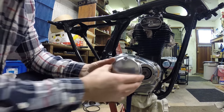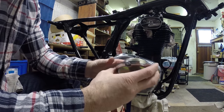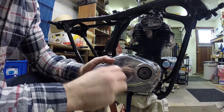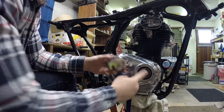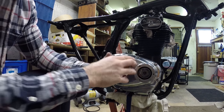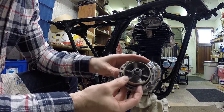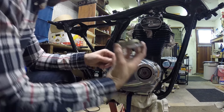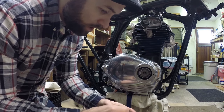The oil slinger cover has a little chip on it — that's a good reminder for me to just take it easy when working on this bike, learning how to be patient, because you can rush stuff and screw things up. There's no gasket here — just an O-ring rubber O-ring, which I already replaced. Slip this into place. There are two vital holes in the cover that line up with two holes here and here — make sure you look at it and put it back the right way, because oil comes slinging out of here and through that little hole. There's a little spring inside that will spring shut when it gets torqued in.